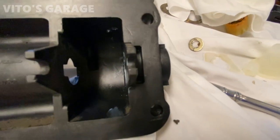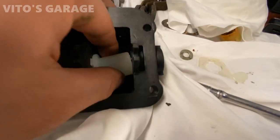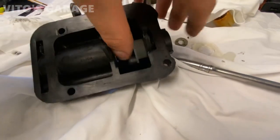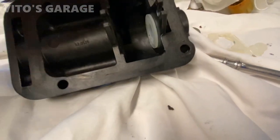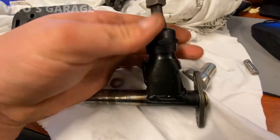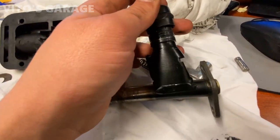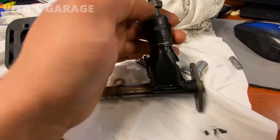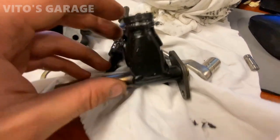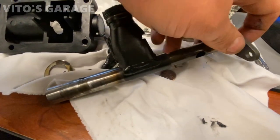I added a little bit of tire lube after cleaning and I'm gonna go ahead and install this bushing. I might have to carefully press this in by hand — should be able to do it. It actually goes in pretty smooth and easily — look at that, awesome! After you take this plastic nut off you can lift the whole assembly — there's another bushing you have to replace. There's that bushing.